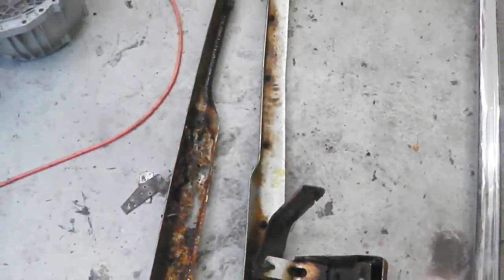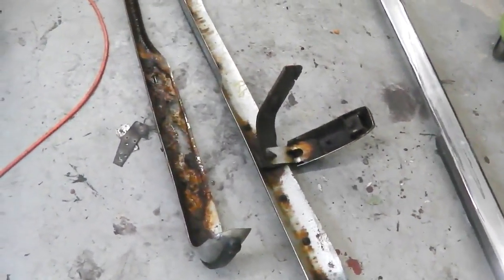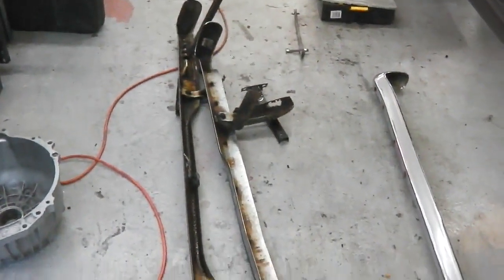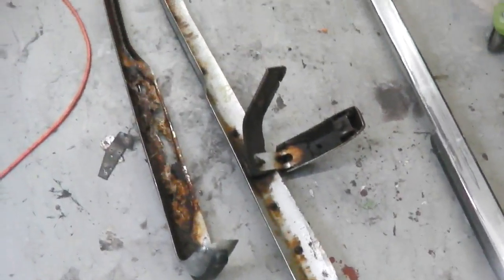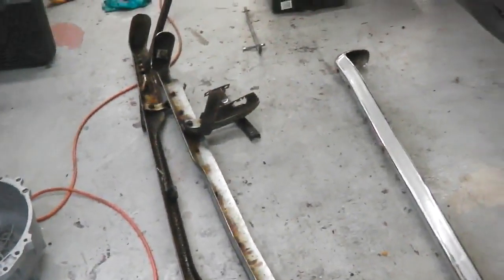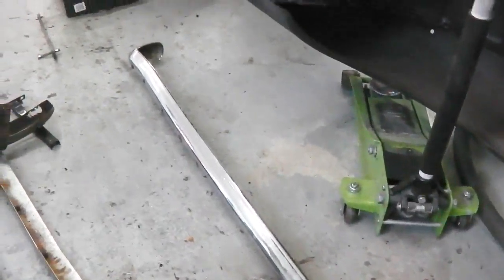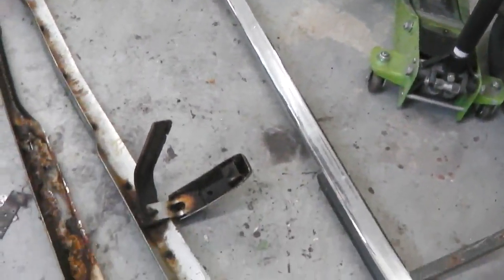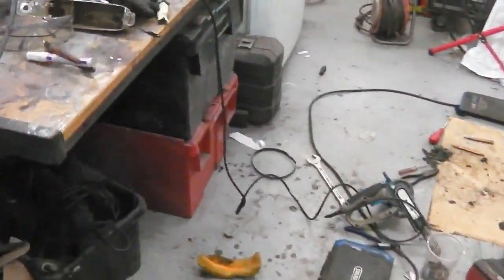So a few little things. Rear bumper irons for the powder coating tub. Front bumper irons, they need to go because powder coating's first. Then clean up the bumper by removing all the nuts and bolts off it, getting it stripped to its bare minimum, packing it up and getting it wrapped and ready to be sent off to S&T along with any underriders if we need them. But we look like we're okay for underriders.